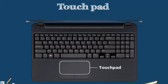After we remove it, we simply purchase the exact same make and model of our laptop touchpad. Get it replaced in there. Get it up and running. We want to make sure that we have the exact same type of touchpad, because even if we have one that isn't exactly the same but just fits, we push it in there and get it to fit, and the cable connector fits right, we may not have the proper drivers installed for it on our operating system, and when we go to use it, it's not working quite right. So we want to make sure that we get the right type of touchpad, one that works with our system, and hopefully replace it with one that's the exact same model as what we already have.